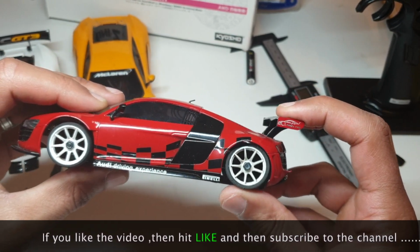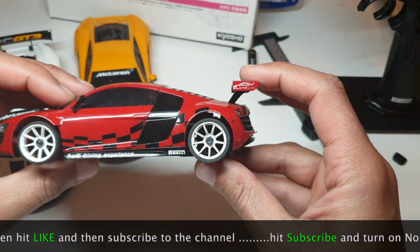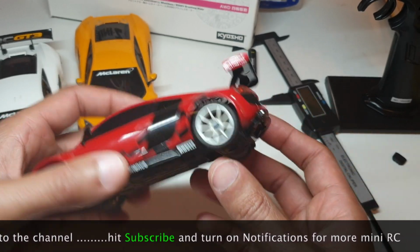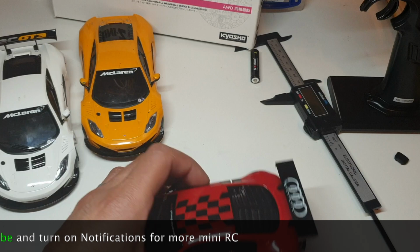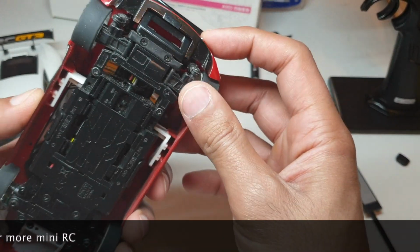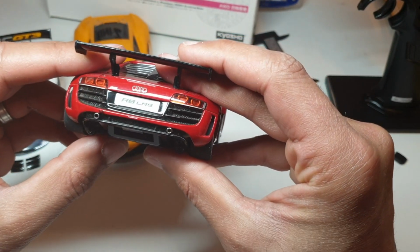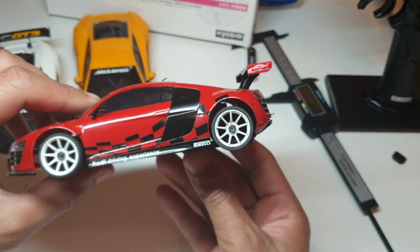Even then that might be too much. I might need to actually move these clips now, but the ride height has been lowered considerably from the last video. And when I replaced the double wishbone, I didn't check this. Part of the reason why I kept more clearance was because there was a big bump when the car was hitting. I felt like it was hitting the shell and the bottom was hitting the ground, but I've just stiffened up the suspension a little bit to allow for that. So we'll see if that now improves the handling and whether it flips less.